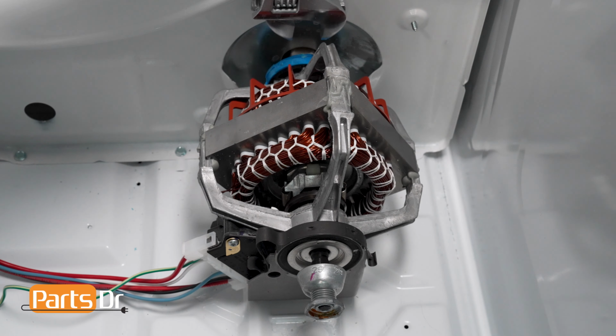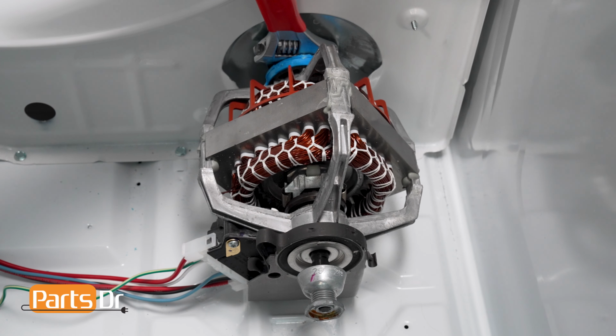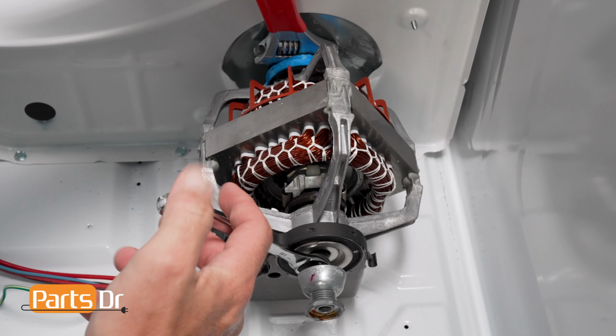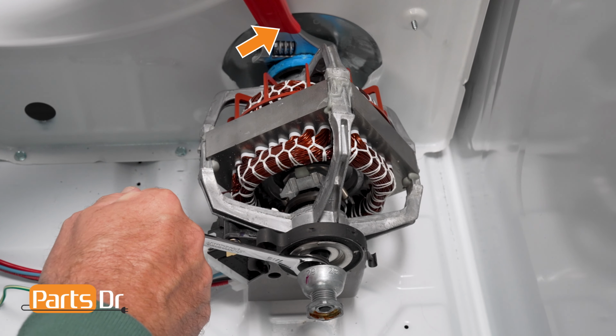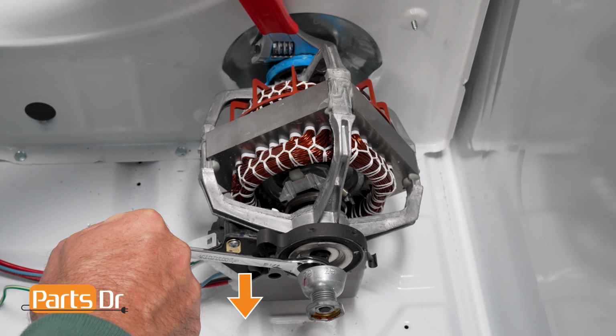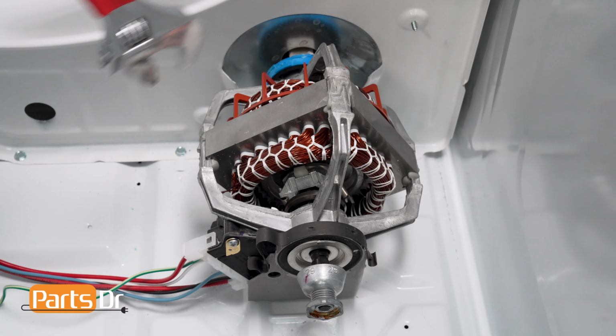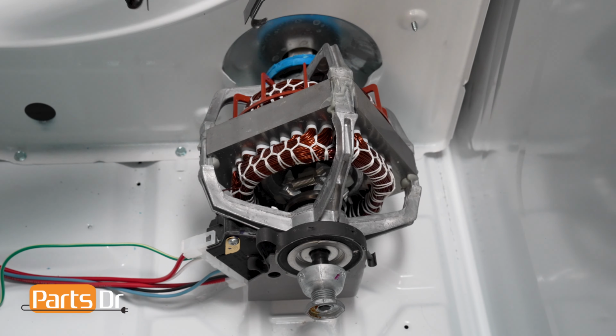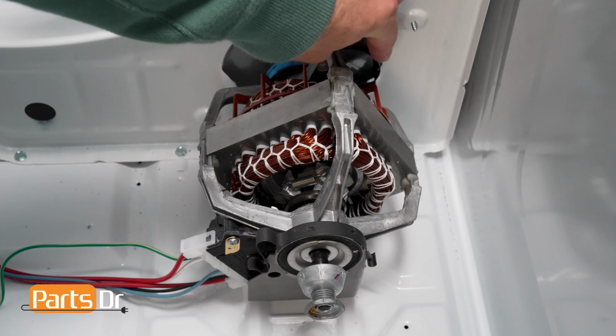Using one of the techniques from earlier, tighten the blower wheel. You do not need to over-tighten the blower wheel. Each time the drive motor starts, the reverse threads on the blower wheel stay tightened due to the rotation of the motor shaft. Attach the rear motor clamp by orientating the metal J-hooks closest to the motor.